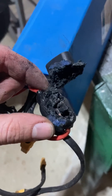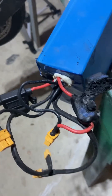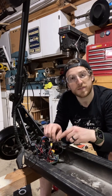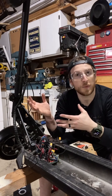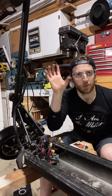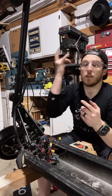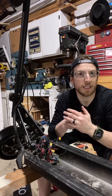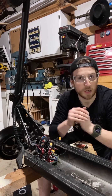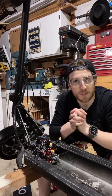It's safe to say I'm not going to be able to reuse this fuse, so I'm going to go down to the auto parts store, grab a new fuse holder and a fuse, and put it back together — not in this video, but in another one. Now, let's say I didn't find the issue on the battery right off the bat. My next step would be to go through all this wiring and see if there are any shorts to the controller, because it's possible it could be putting out a false code. I would also go up this stem and check out the display unit for the controller, see if there's a loose wire on there — that's something you'd want to check first because it's one of the easier things to do.